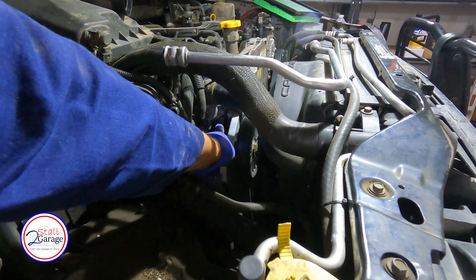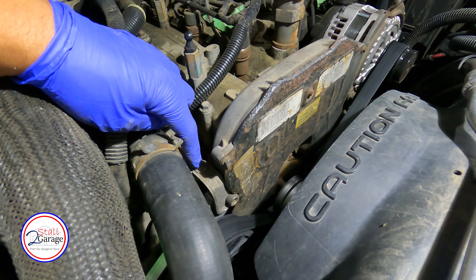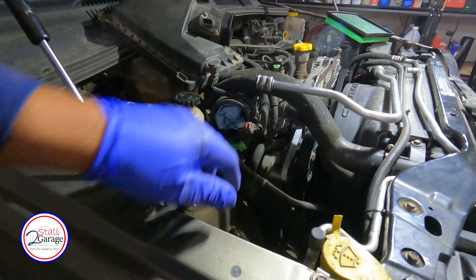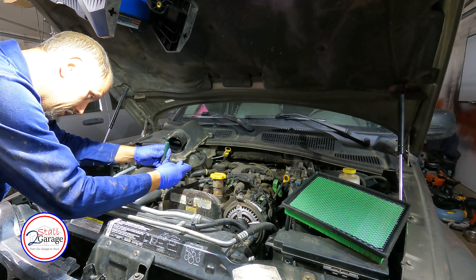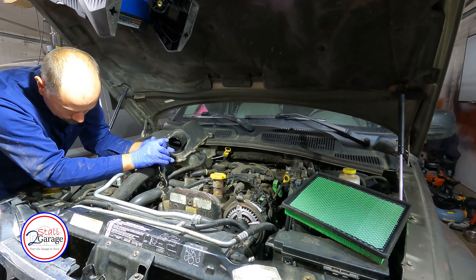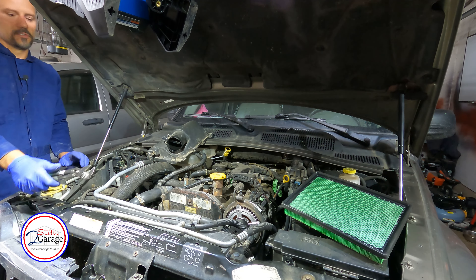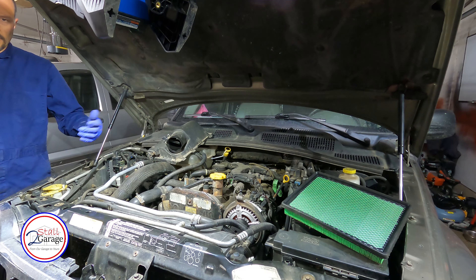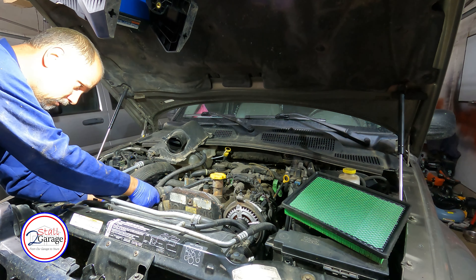Now that the airbox is out of the way, right down here — this is one of our three small bolts holding the thermostat housing. You've got one right here, one down here, and one just underneath. I may or may not have to take off that hose right there. There's just air in that hose. I'm going to take this hose off now — this is a constant pressure clamp, which is the kind you want. I always take the tools I'm using for the specific job and put them off to the side where I can get to them.